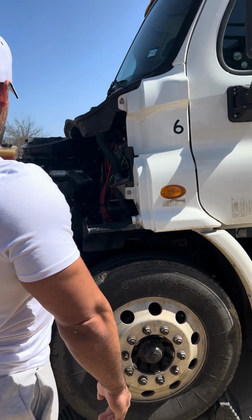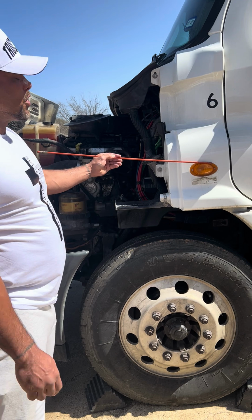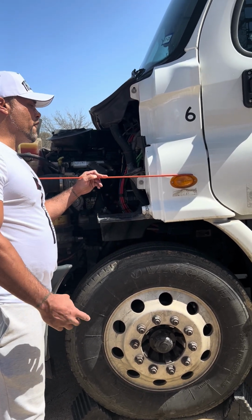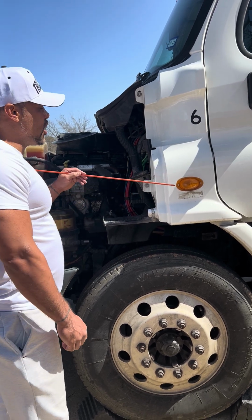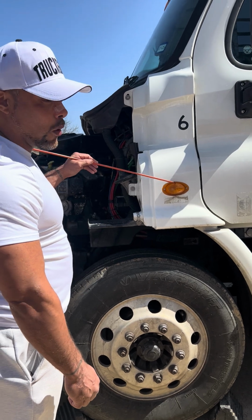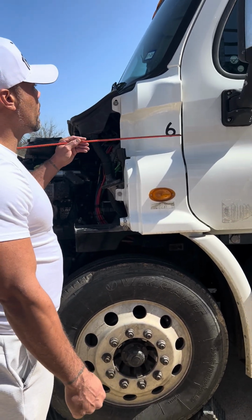Another once over from my hoses. Nothing I've missed. I have my clearance light, my turn signal and my four-way flasher light. It is amber in color. It is properly mounted, secured, not bent, broken, or cracked. All nuts and bolts are present and tight. It is used for turn signaling and four-way flashers.